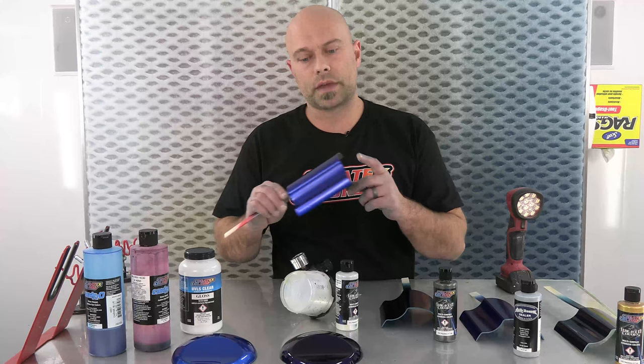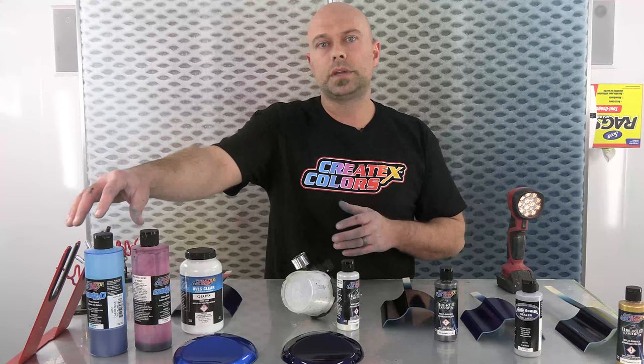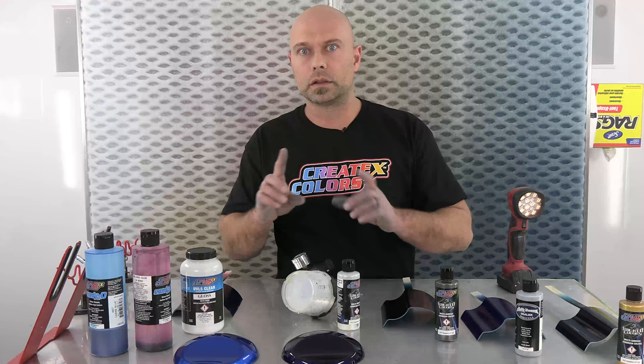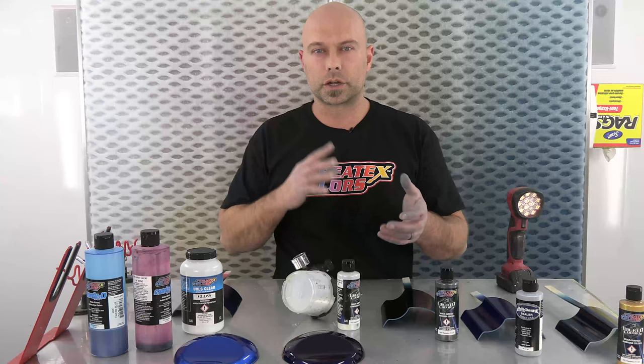The Flare Blue-Violet is going to give a soft kind of pearl effect, but because it has that color shift, it's going to bring out both tendencies. We blended two candies here — a Sunset Magenta and a Carib Blue — so we have a violet and a blue. It's going to key well to both ends of that color spectrum. This is not for real color saturation — two to maybe three coats max, just a medium coat, an effect coat, a control coat, if you will.